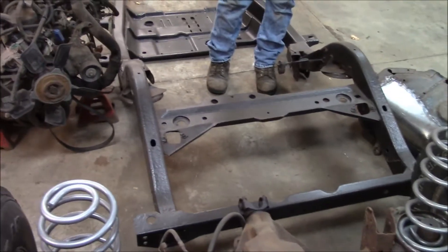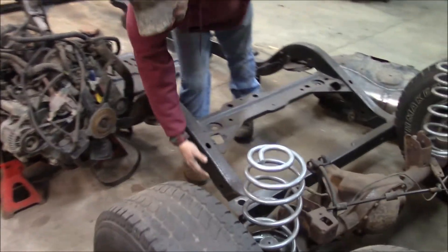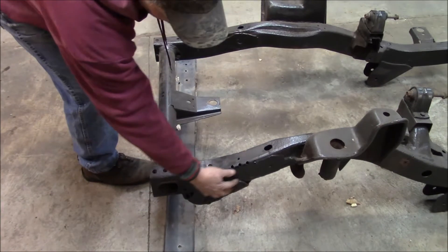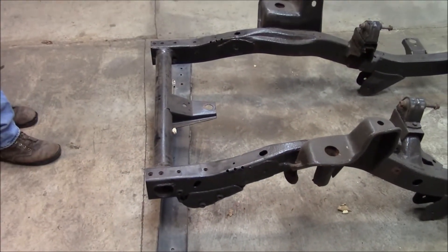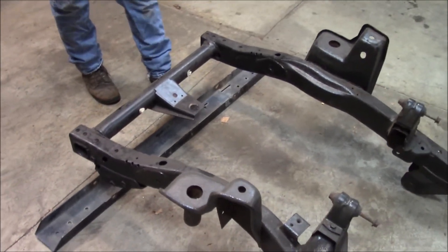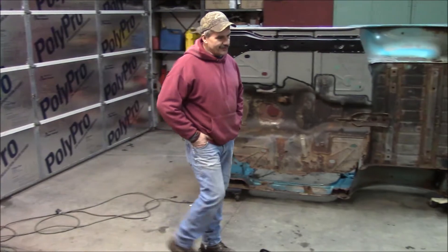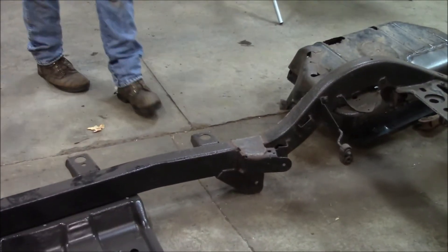So this is a whole other frame that you rebuilt? Yeah, I picked it up on Craigslist — a kid had started a little project then ended up buying a nicer Jeep. I patched the rear part of the frame because it was completely rotted out, and it was very bad in the front — cracked, and a lot of rust around the steering box. It had been patched in several places. So I found a TJ in the junkyard that was wrecked but solid, cut the front of the frame off, used these oval holes on the top and bottom for reference, squared it up, made my cuts, lined it up, welded it on, and added these fish plates for strength. It's a lot better than the frame I had, and I added some plates to make it stronger so that in a few years I wouldn't be taking that apart.